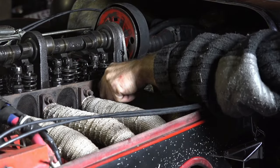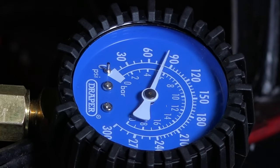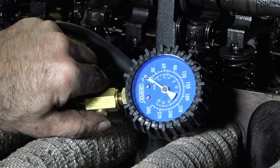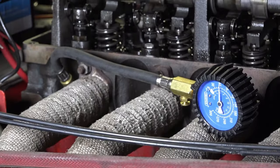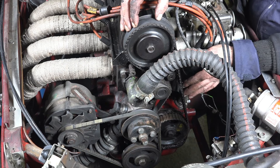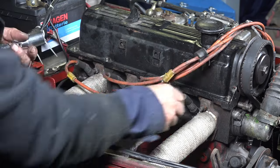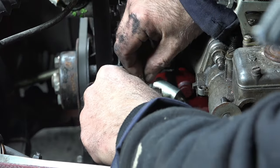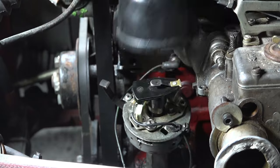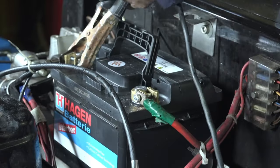Another good test is to verify that all cylinders have proper compression. As you can see it was only 6 bar, but that was because I did not have the carburetor fully wide open. We also need to check the timing belt or timing chain, because cranking up an engine with a timing belt that is off will destroy the engine. Then finally I cleaned up the breaker points, although we will replace them later with electronic ignition.